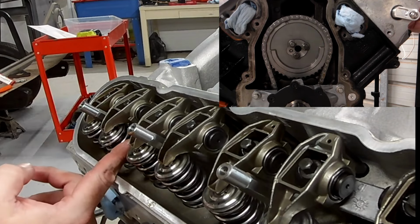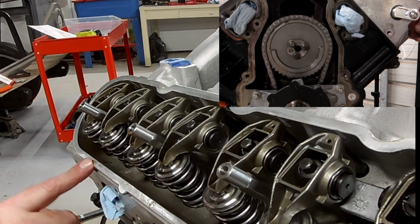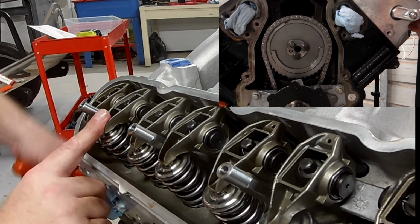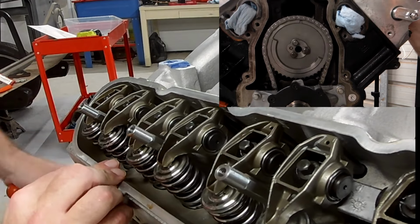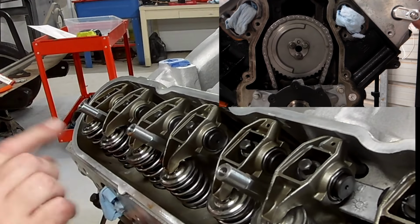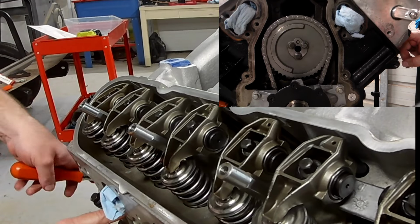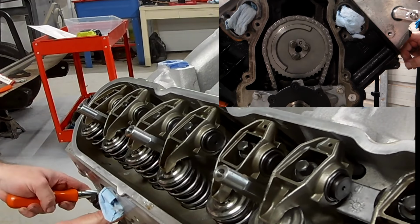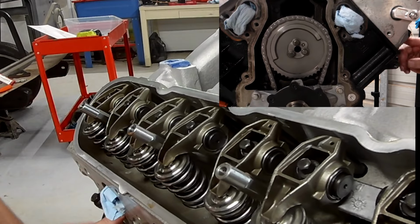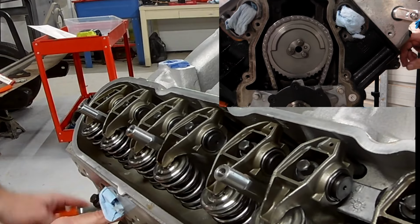If you're watching the exhaust valve and you see it travel, start to open, and then come back up, whenever it's almost completely closed, get a screwdriver or something and put it in there and bring it up until you can tell it's all the way up. Continue to turn it to where it feels pretty much level and stopped traveling as far as piston travel, and you will be at TDC.